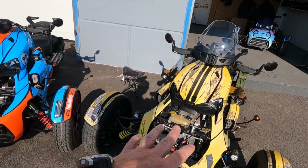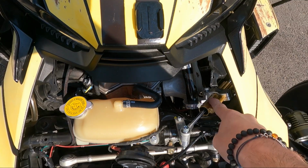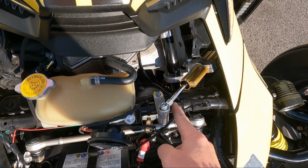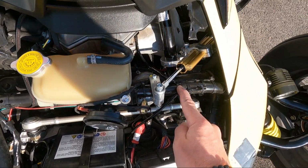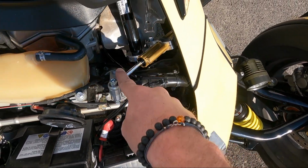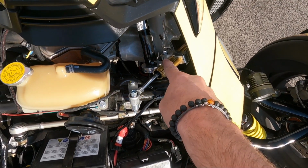Now, one tip, in case this is super strong for you, even in the setup when you will use the YSS. I didn't test it yet. It's just physics, all right? In case you move this bracket closer to your steering bar, you will make this less powerful. So let's say finger closer to it, it will be less and less powerful. The smaller the distance between the steering bar and this crossbar, the less powerful the damper is.